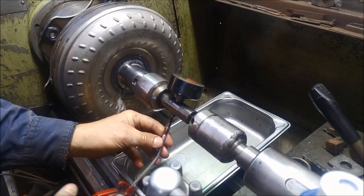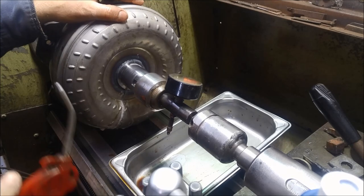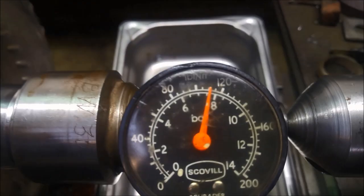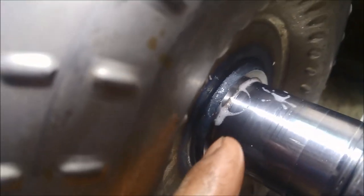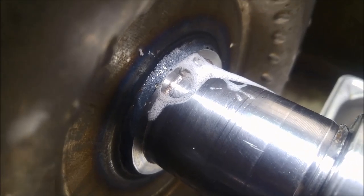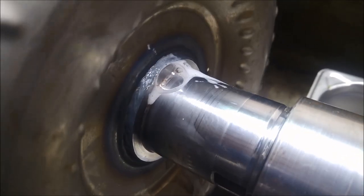There's pressure really running away there quickly somewhere. We're on just under 120 psi and you can see I've got the soapy water on there. You can see there's a big bubble forming already. So that'll be where the leak was coming from, or the majority of the leak.